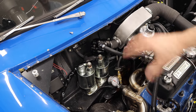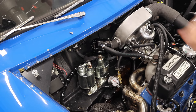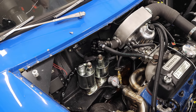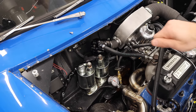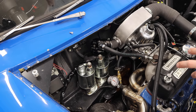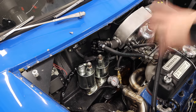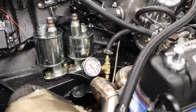What I'm going to do is send power to my fuel pump via the key. I don't have any spark plugs in here, and I'm not going to be spinning the engine over yet — I don't want to run fuel into the chambers yet. All I'm doing is turning the key on to engage the fuel pump. That will start running, we'll see this little gauge go up, and hopefully we won't have fuel all over the place. Good idea to have some rags available just in case it does start to leak — if it does, just turn the key off, fuel pump will turn off, and we'll be able to fix it.